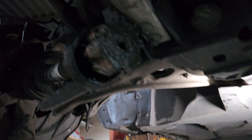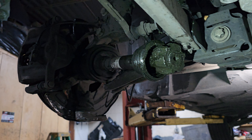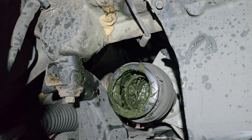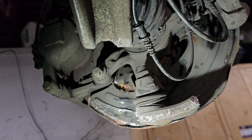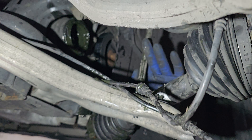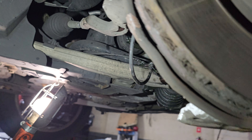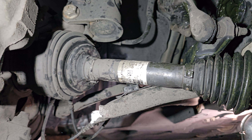If you notice here, our advice is to drive moderately. Why? Look — the axle snapped out. And the reason why is the lower control arm is broken, you see here. And also this thing bent. This one also snapped because the stabilizer link on the top also broke. The whole problem is here — you can see this is snapped out.